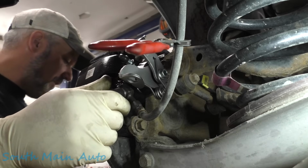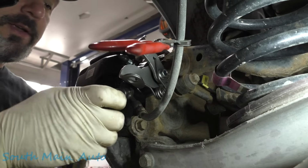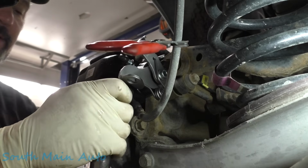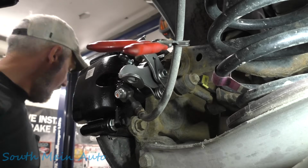We'll get our spec wrench here. Makes everybody happy. They can't complain about us if we do this much. We're even a torque man. Who torques banjo bolts? Huh? This guy does. Just keep going way beyond what you think it should be. Put it at 30 foot-pounds.